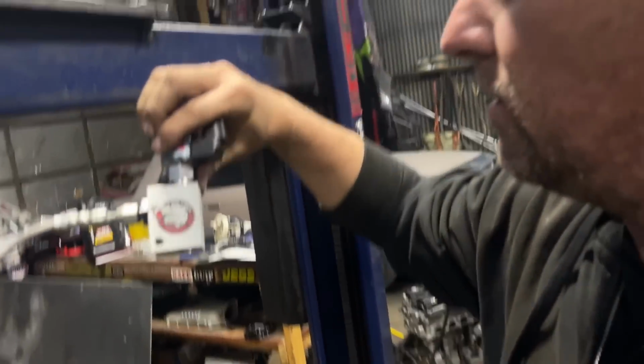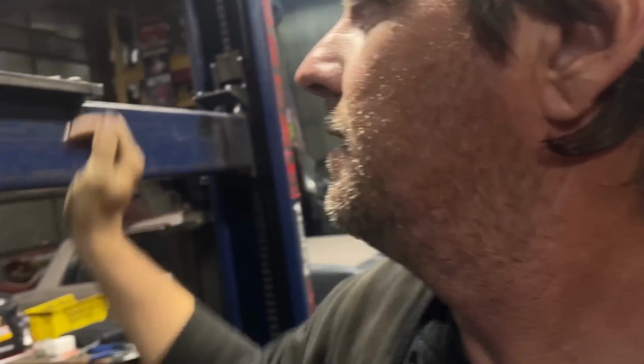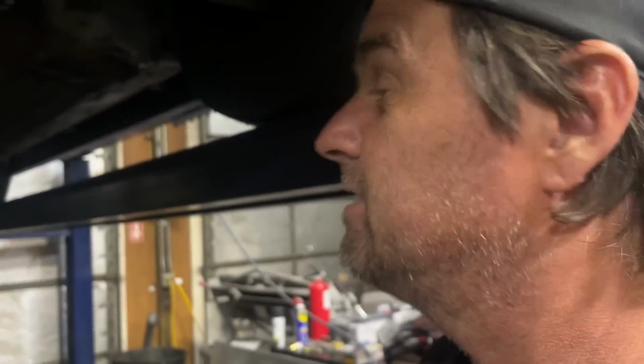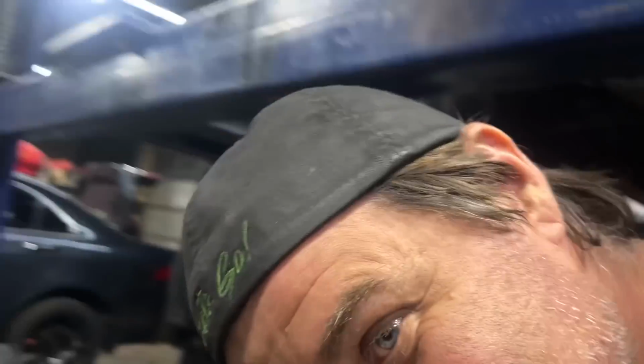They hooked us up with that. And in the front, we're just going to throw a little Hall sensor on the ABS ring. Also got the Bang Shift Billy. I need to wire up and set up and get a handle on that as well. So that'll be our slipper valve for the clutch. And then we'll get these speed sensors done. This baby ready to no prep race this weekend.